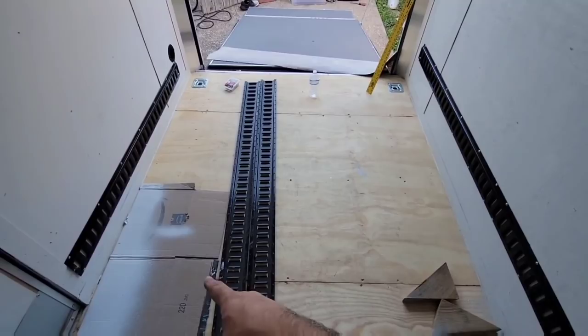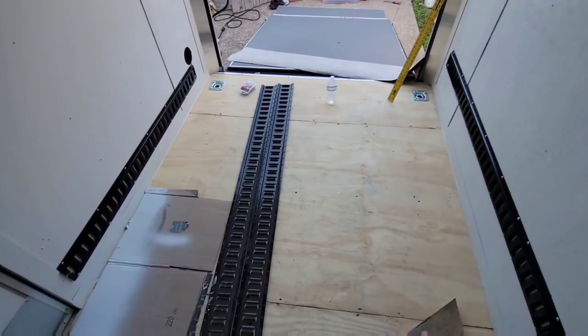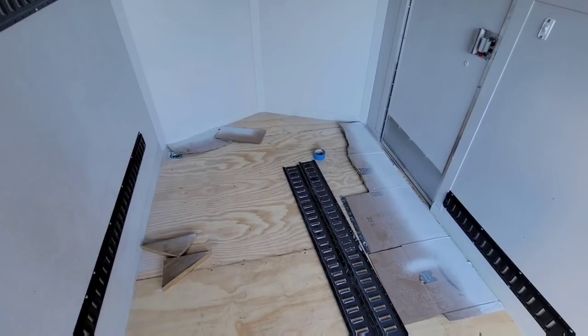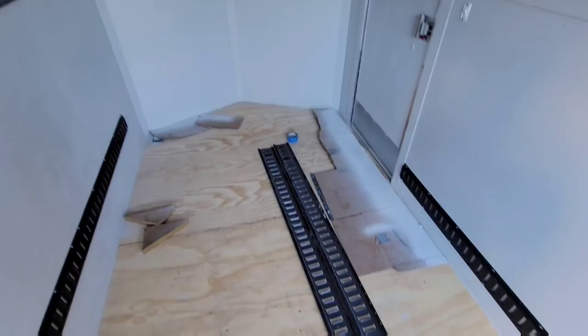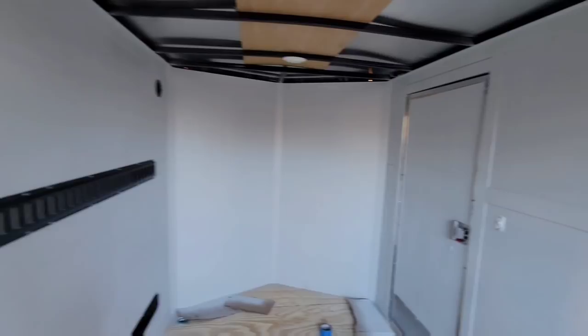We're pretty much done with some of these projects that I've been wanting to do. I'm still thinking about putting a little workbench up front — it would just take up maybe this area of the front, giving me a little room to store some supplies, maybe some ratchet straps and things like that. Overall it's coming along and looking really good. Once I get the flooring in, it'll look even better. I'm going to put caulking on the seams so air can't come up, even though this is tongue and groove — you don't want your flooring to lift up if air gets underneath. I sure hope you enjoyed this video. Please subscribe to my channel, give me a thumbs up, and we'll talk to you again very soon.